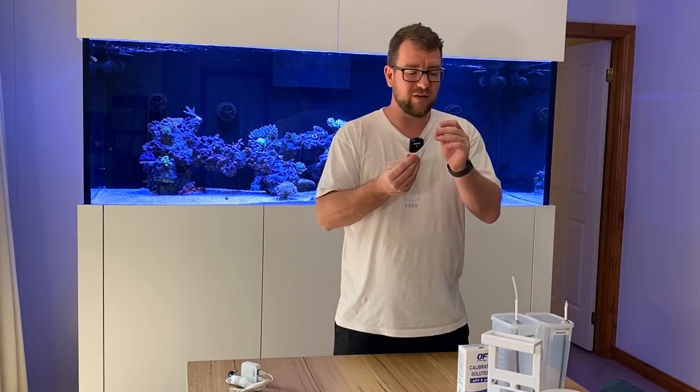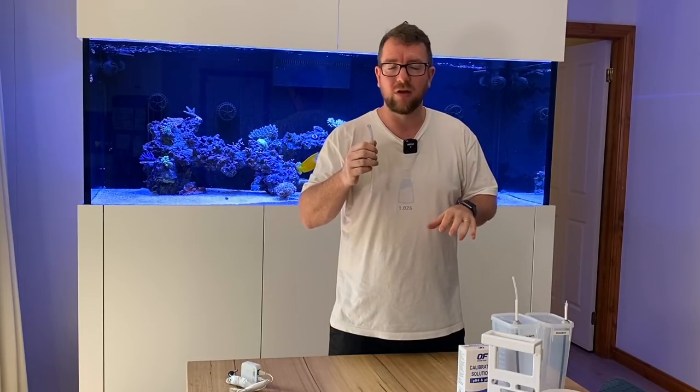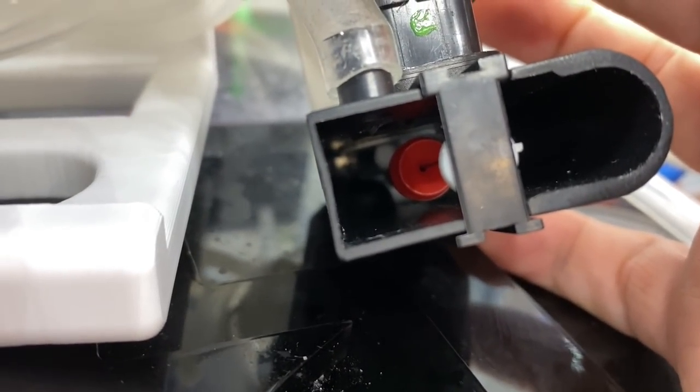I've got a little bit of hose here — I think it's about 3/8 inch size. I like to hook this onto the drain, just in case something goes wrong and your unit overfills, so you can direct that wastewater out exactly where you want it rather than just having it overflow. The unit has a little drain port on it — plug some hose onto it, makes life much easier.